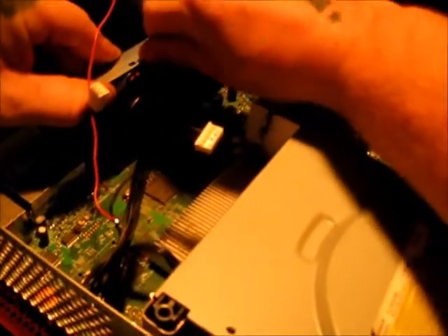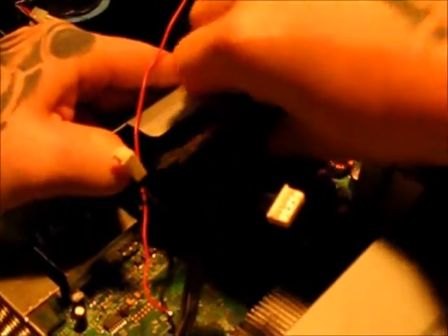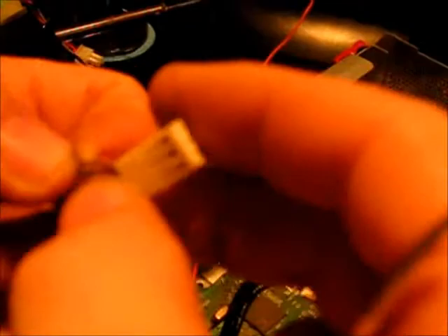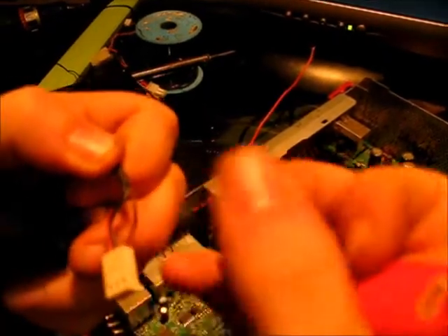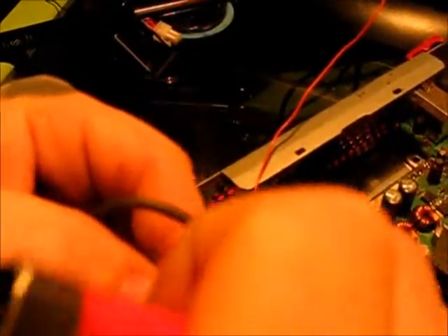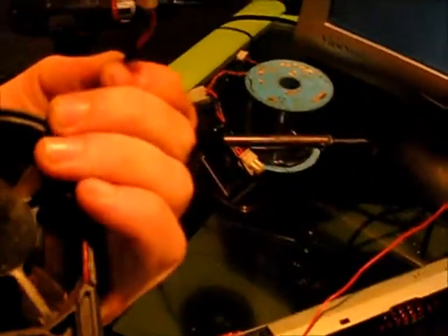Let me go ahead and do this. Fan pops out — get this here. If you're using the method I'm using with the lighter, I'm going to separate them a good bit, hit them with the flame, just peel that back just a little bit. I'm going to end up with that bare wire. Do the same thing with the red one. Now if you only want to do this to one fan, you can. Brown's one, red's the other — brown, red. I'm going to go ahead and do them both.